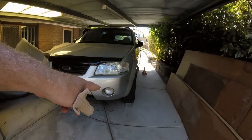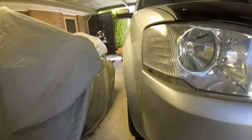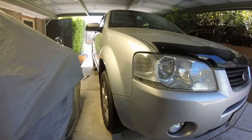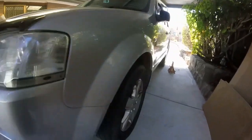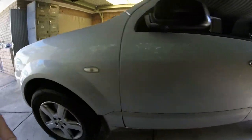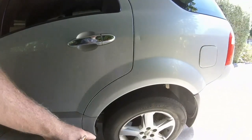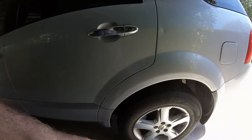Don't forget to wheel-chock the front of the car. When you jack it up, have those wheel chocks in place. That one wasn't tight until I jacked it — it moved a little bit — so make sure when you've jacked it up you double-check your chocks; you don't want the car rolling forward. I'm doing one side at a time, which leaves me with a wheel on the ground at the back for stability.